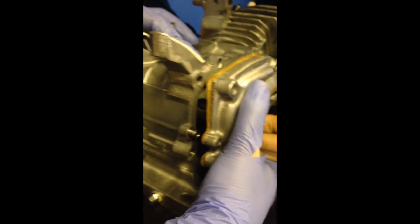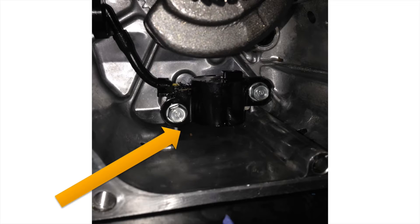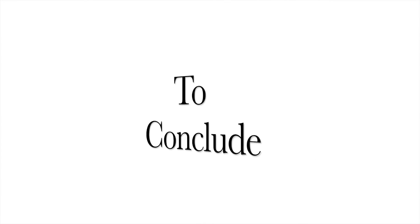Compared to other engines, the splash system requires fewer parts, which means less chance of failure. The engine is sealed in the chamber and can be filled and drained through these plugs. The Honda GX also has an oil level sensor that can tell us if it's running out of oil.